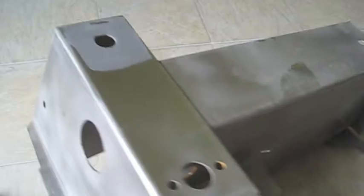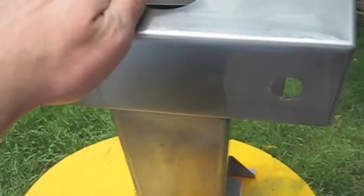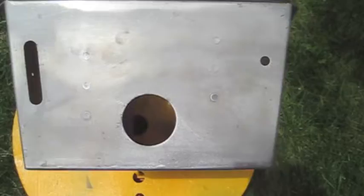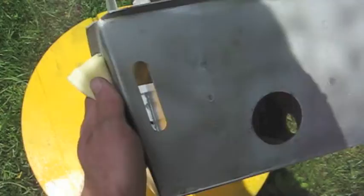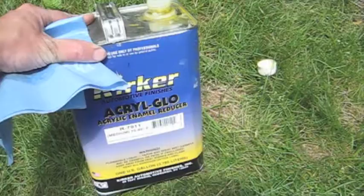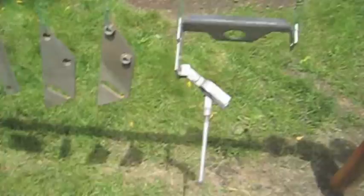I don't think you're gonna see that at all — I'll show you when it's painted and we'll see how it looks. Getting ready for paint now. I just want to show you: wipe everything off with reducer before you paint to make sure you get all the fingerprints off and any grease that's left. Then use tack cloth — it's kind of sticky — to wipe everything off and pick up any lint. Wipe first with a lint-free cloth dampened with reducer, then follow up with the tack cloth.